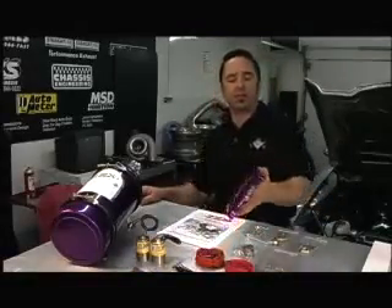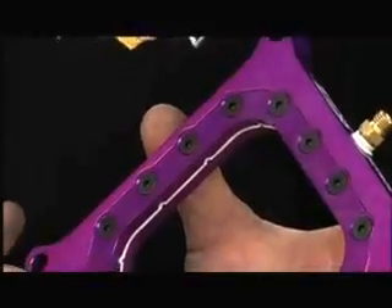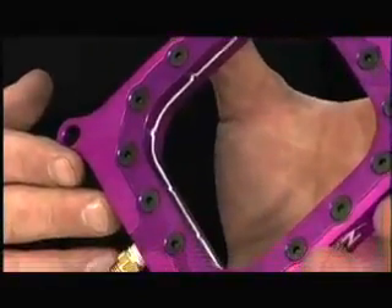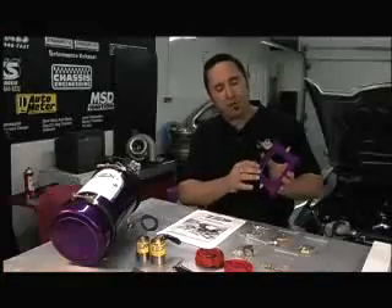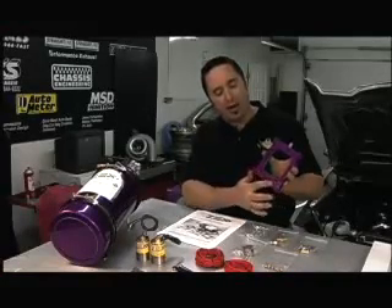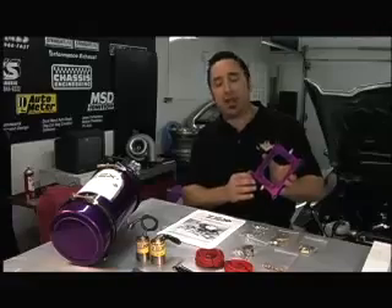The thing I like best about it is this bolt-together plate — it's an amazing piece. The perimeter design means that the fuel and the nitrous, instead of coming out of spray bars, is actually coming out around the outside edge of the plate. It's amazing for distribution.